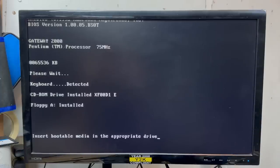Power on. That's not good — it either doesn't like the CPU or doesn't like that RAM. Let's figure that out. Weirdly enough, it boots with the POST analyzer card in there. So that's weird — maybe it just had to load its CMOS settings? Who knows? Let's go ahead and get a DOS boot disk in there.